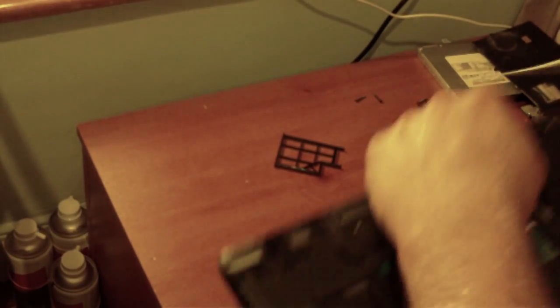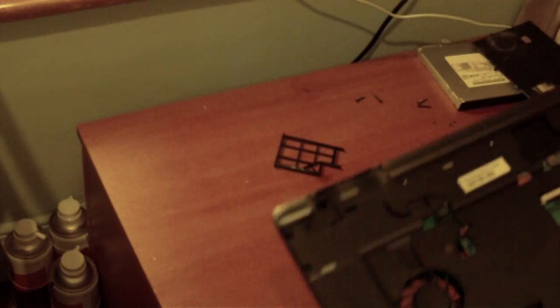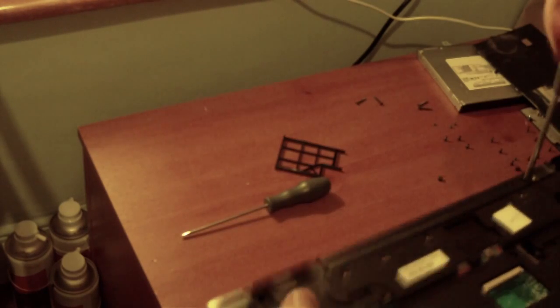And I think it's just one of the screws right there. It's under a rubber cover. So it's almost immediately along on the right hand side from where the feed cable is, about 2 centimeters from the top screw. Make sure you undo that or you're going to have a very bad time. You're going to ruin your case.